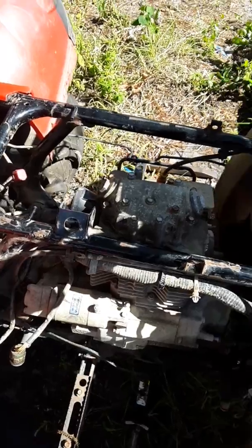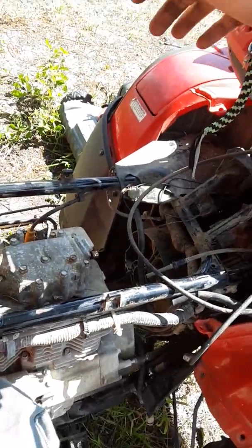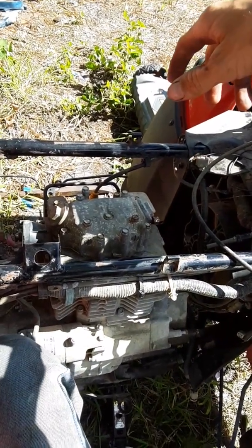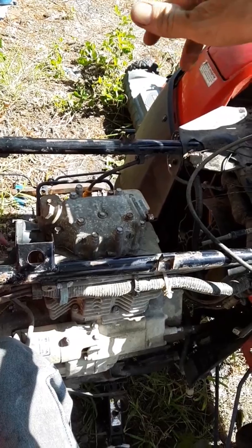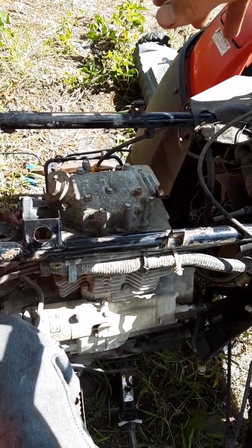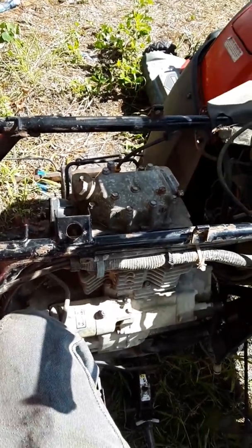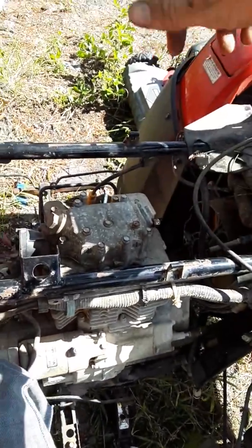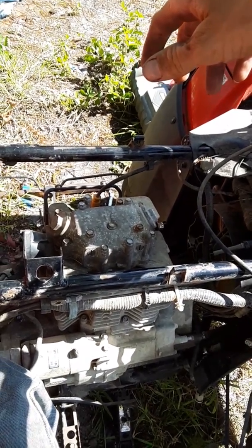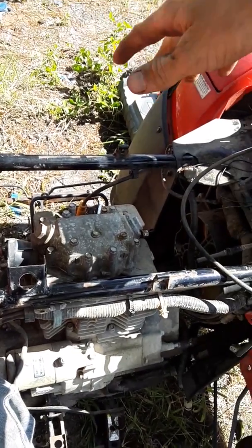it's actually a buddy of mine. He went off and he bought it from somebody. It quit running on them. I went through it and it had a bad valve. One of them was actually bent. I think it might have jumped time. From the top end, looking at it, I didn't see anything wrong with the top of the piston or anything like that. It does have compression now. Everything else perfectly. Still no start.